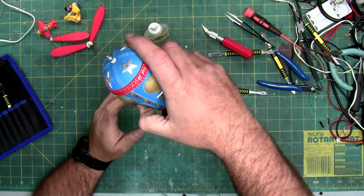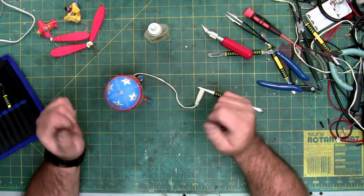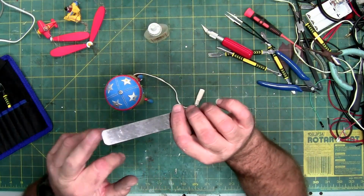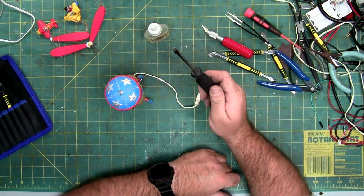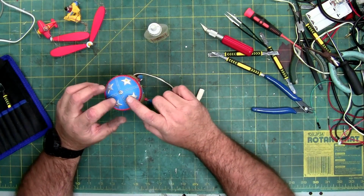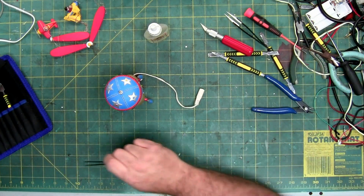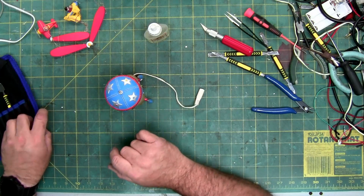And now that it sits flush, you can see how much of that bushing actually sticks up. So, but there we go. So, tools, definitely going to need a heat gun. And spudgers, and not these flimsier ones that I like to use, but the more rigid ones. You can probably get away with using a smaller flathead or blade screwdriver. And patience. You saw the amount of patience. And then make sure you pop off that plastic retainer, bushing, whatever they want to call it during assembly. But whatever you use, just take your time so you don't break the resin cap.